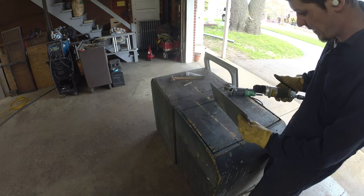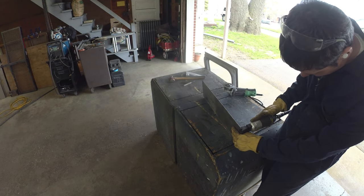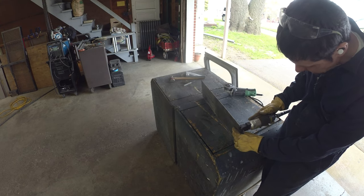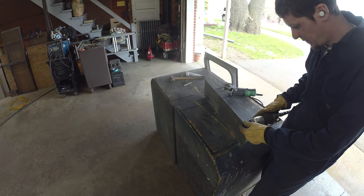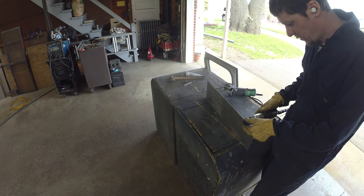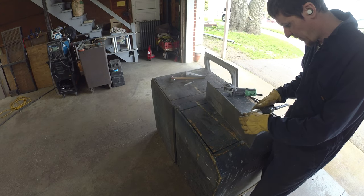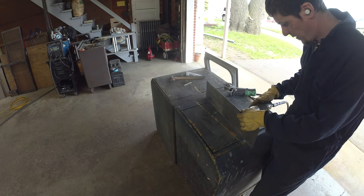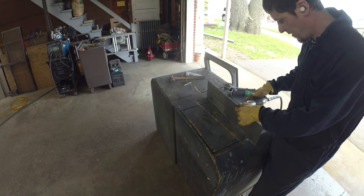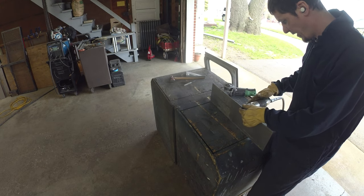Gonna cheat a little bit, use the panel flanger just to get a good even line across. Conveniently, it's about the same size as the pinch roll on these panels, so it actually works pretty good that way, provided you've got a straight edge to work from. It helps. Even if you've got a little break, it probably wouldn't hurt to give you a good straight line across, a good even cut. Provides kind of a natural weak point to bring it on around.